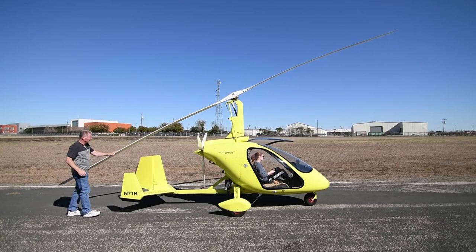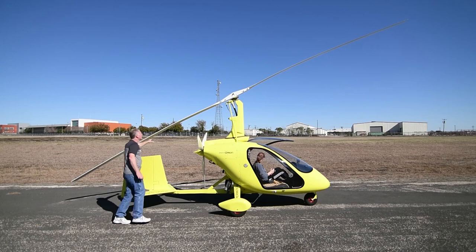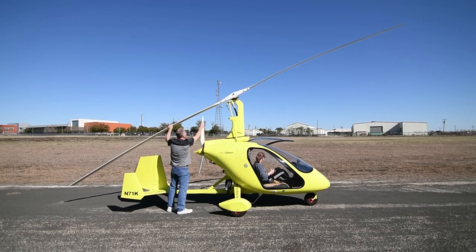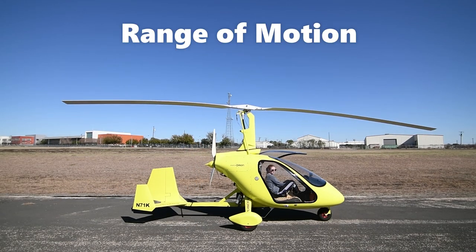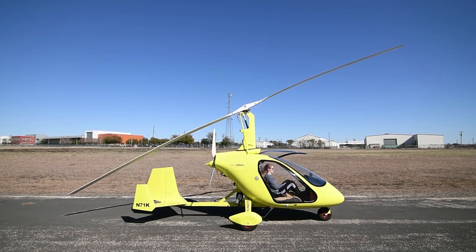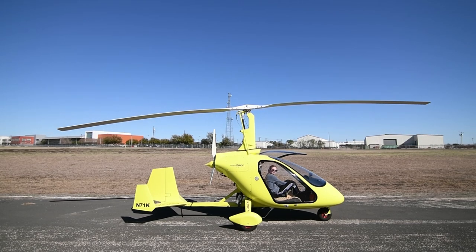In this video, the rotor is fully back. You can see that there's not a whole lot of clearance for the propeller, the tail, or the ground, maybe 2 inches. It's also one of the reasons why when taxiing, we hold the rotor forward. This is to avoid blade flap and the rotor impacting the airframe. When taxiing, we avoid a damaging blade flap by keeping the stick forward. You can see what happens if the stick is moved back versus forward.